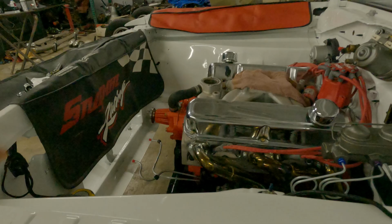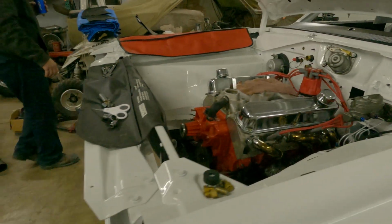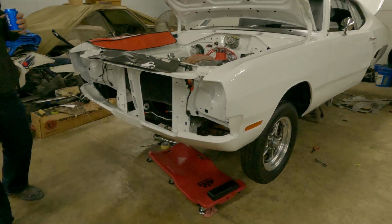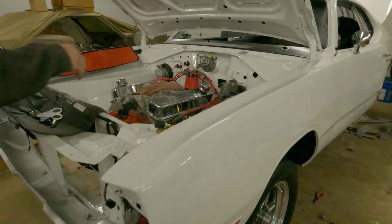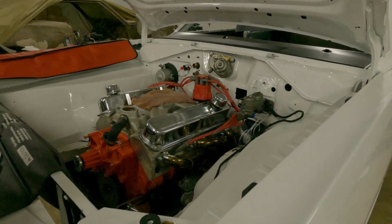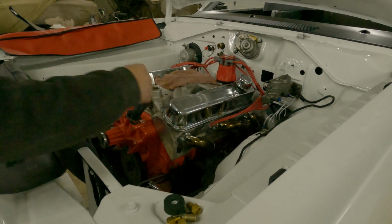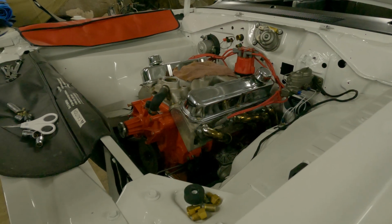And what radiator are you going to use? I don't know yet. Yeah, ordered trannies in. Had to get longer header bolts. The ones I had were only 3/4 inch, and with these thick flanges, I was only getting about a 1/4 inch into the head. I didn't think that'd be good. That ain't quite good enough.